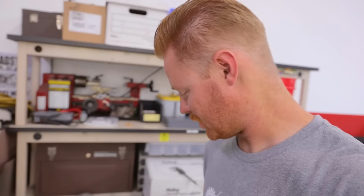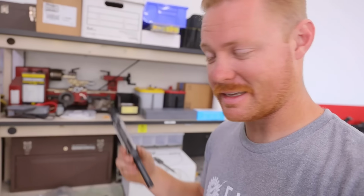If you have no specialty machine tool, like a reamer or anything like this, you might have a rough time getting this together. Your alternative is basically taking your ID measurements to a machine shop, putting the whole thing together, and then giving them your spindle and/or beam and telling them to ream it out to the kingpin, and bring your kingpin with you. As long as you have a good machine shop that doesn't suck, you should be fine. But I'm going to do it myself because I do have some of the tooling, and we'll see how this goes.